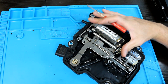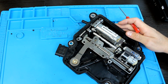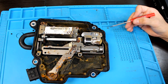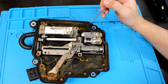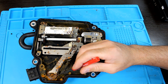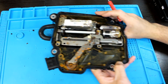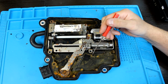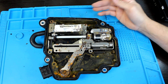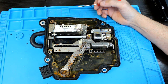These do have some failures still — they're not inherent to the same exact style where the tooth area would go bad. However, our problems with the DSM are different. We do have issues with these things sealing. Normally they have a rubberized coating around the exterior that seals it from the inside as well as between the outside of the transmission case and where it engages the actual transmission. So they do have issues with water damage. Some of them still communicate, but some of them don't, and you're left with the same circumstances — stuck in park, unable to put it into neutral until you remove the housing from the transmission case and physically shift it into a neutral position.